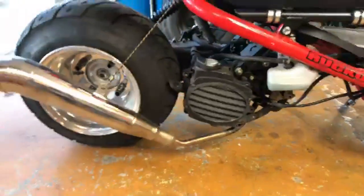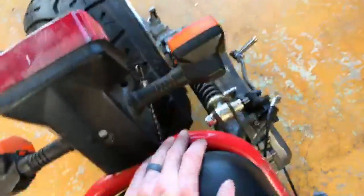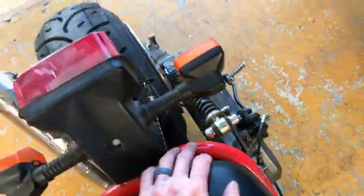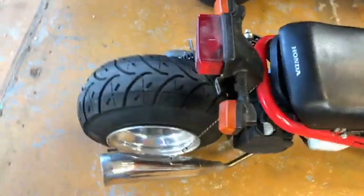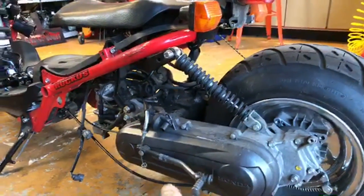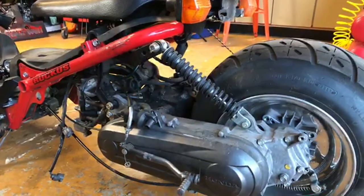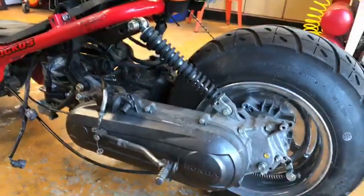I've got this exhaust I'm going to pull off of here. This thing is totally jacked big time. It looks like it's been rubbing on the ground, because if you use a stock shock on a stretch like that, the suspension's so weak. So you guys that are doing a stretch, don't even think about running a stock shock with a stretch. I know this was probably temporary for the guy that owned it, but you need to do something beefy like a shock like this.